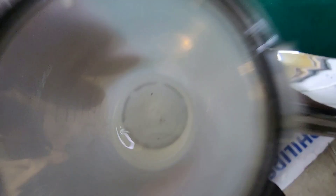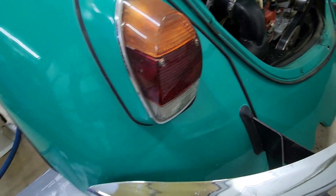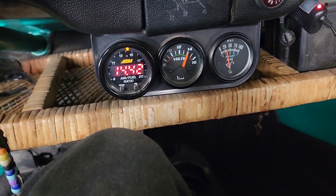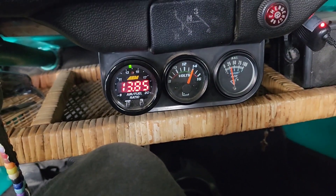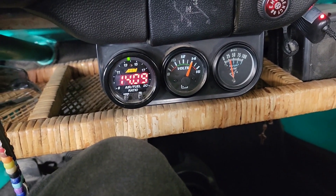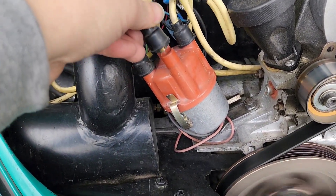Look at all that - we have the largest debris piece on number four, and all the other debris is from number two. I'm gonna go ahead and put this back on. Theoretically it should turn on perfectly - though I give it another couple of months before I have to do this over again. It looks like it finally stabilized - 13 to 14 AFR on idle, that's pretty good. We're gonna call it fixed.